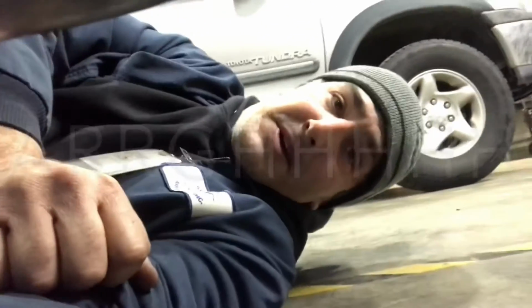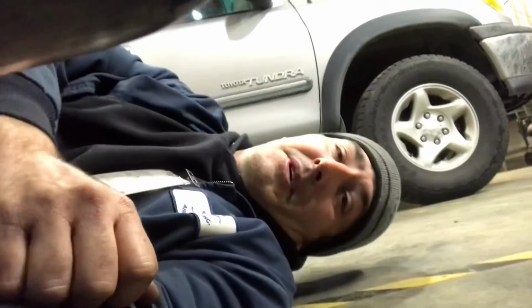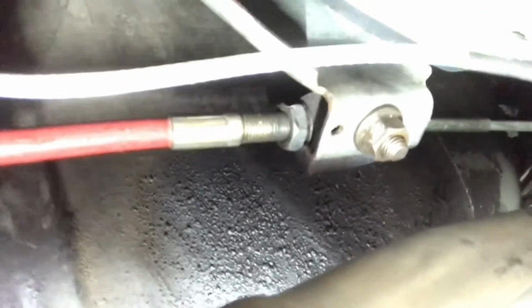You know, I tend to take really simple projects and make them extremely difficult. In the end, we got it done. There's our bracket that we ended up using. I had to make an L bracket and put it on top of the stock adapter there. And then got the idea off Lokar. They make an AOD bracket assembly that you have to replace inside the AOD, and it's slotted so you have infinite adjustment. I figured, hell, I'll just do the same thing. It just took me 4 times longer than it should have. Whatever, but it's done. It's alive!